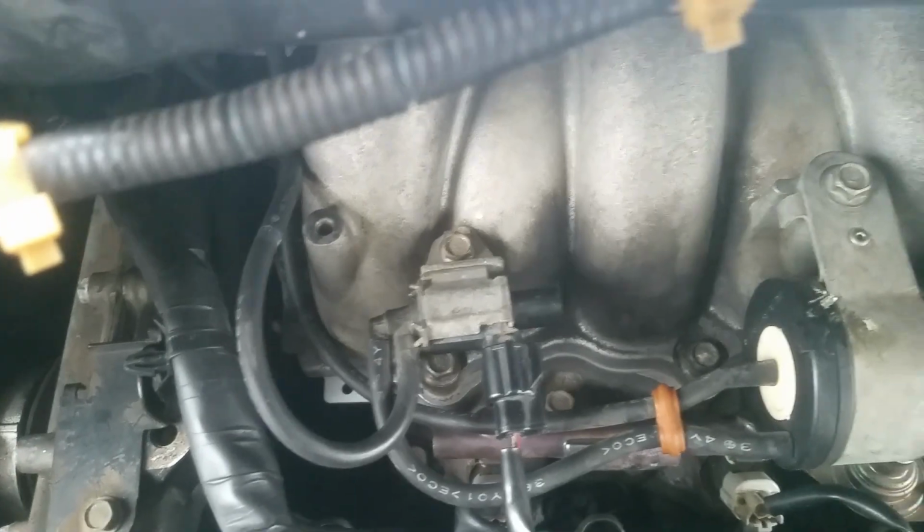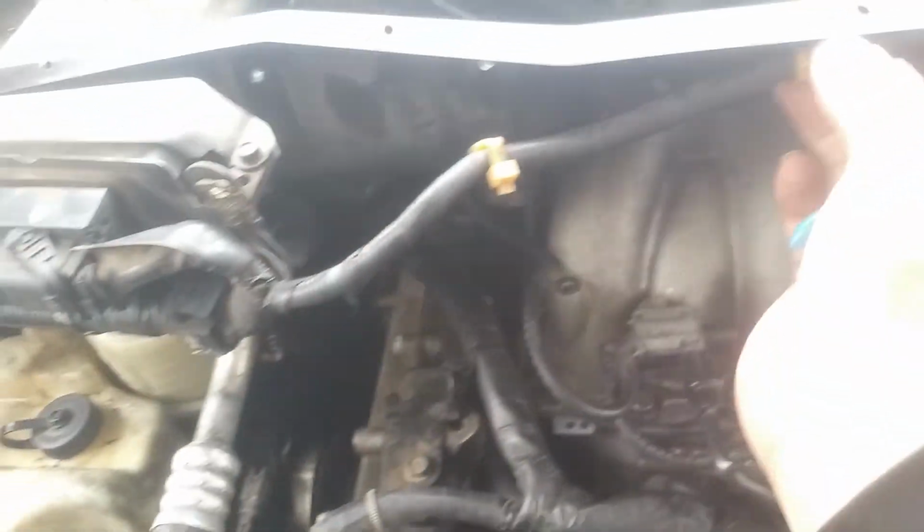Okay, with that ground loose, it also holds the bracket. We got that one, and this will pull out of here. These are snapped in. Just give them just 1 second. Okay, so if you have some needle nose, just squeeze those so you don't break them, and they'll usually push right through. There's one. And there's that one. We should have enough slack. That's good for now. We've got another connector right here, and it just came loose. That's just for the auxiliary pump there.